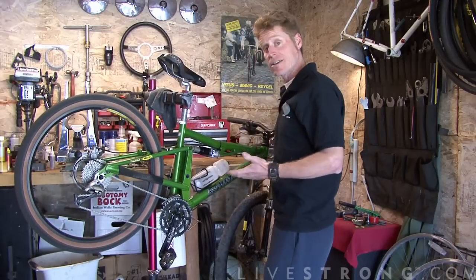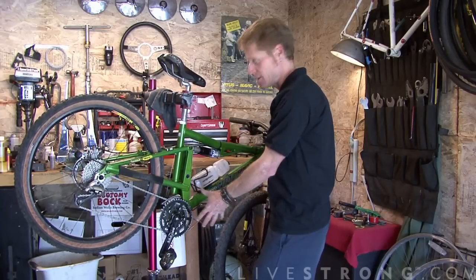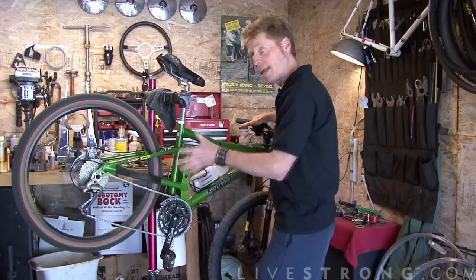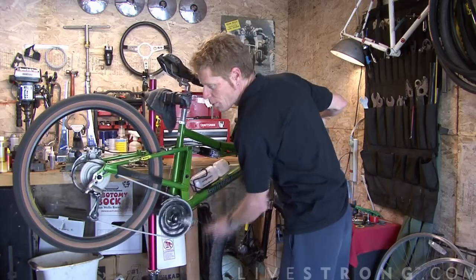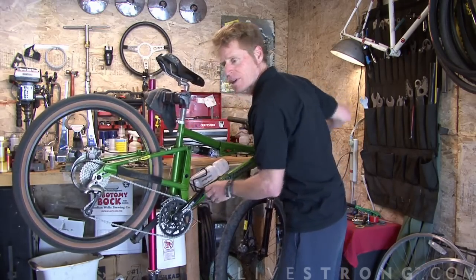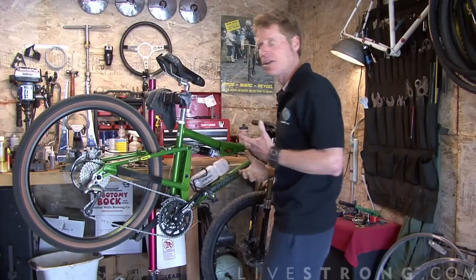As your speed increases on a bigger downhill, that's when we employ the big chain ring in the front. Push the thumb button on the left hand, brings us up into that big gear. And now again, we have full control of the rear to fine tune that pedaling cadence. Make sure it's comfortable for you. You're not mashing your knees, but you're not spinning out. That's the range you're comfortably looking for.